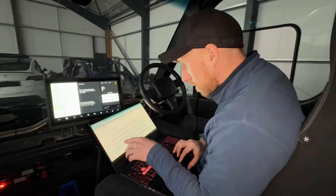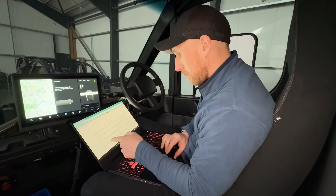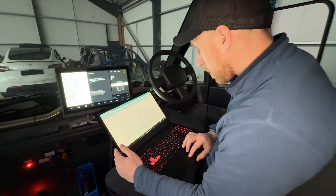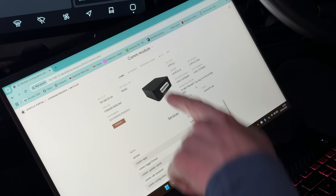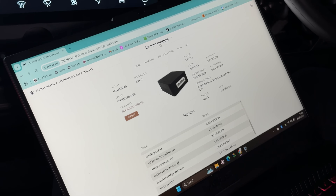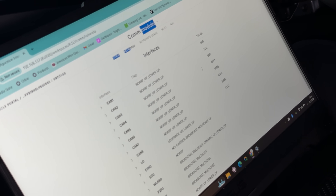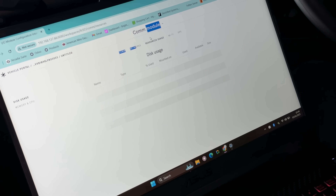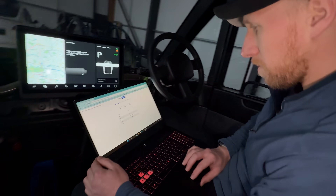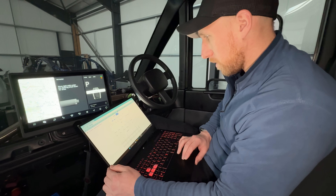Let's see what else there is. There must be something else up here — so that's the vehicle information. Barry apparently is its name. There's a dropdown here which has device comms module, and you can see information about it and more information about ports and all that stuff, which is quite clever. We've also got network on here, the CANs, all the CANs and the speeds which they're running at and broadcast rates, useful resources — probably telemetry information — Wi-Fi information, and GPS units all in there as well.